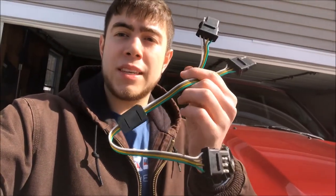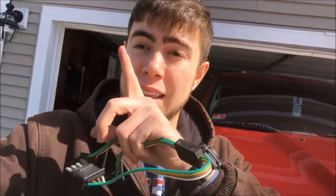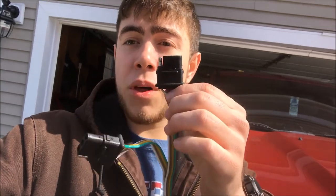I had to step outside because of the heater. If you're not going to tow with your truck, obviously you can leave the LED light cover in there. But if you need to take it out sometimes, you're going to want to get a pigtail connector. Cut off the single end, solder that into the wiring - you can get these anywhere: Walmart, online, eBay. The flat connector from the hitch cover plugs into the pigtail, and the other end is just left alone for whatever other use when needed.